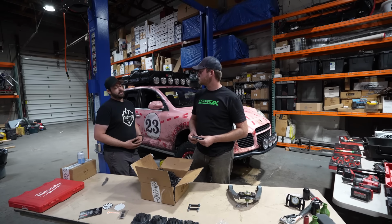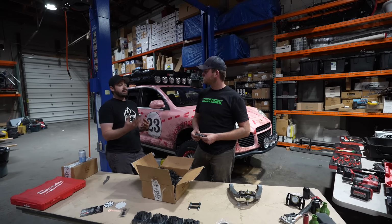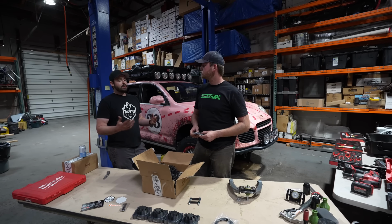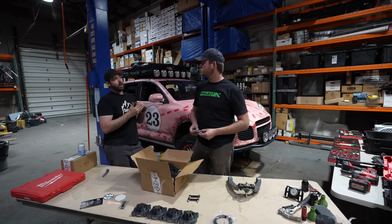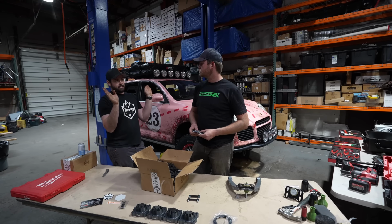Another reason why we went this way over an adjustable end link is because we keep the rod ratio correct. So when we install everything, I'll show you what I'm talking about rod ratio wise, but essentially if you go too short on the level link, you'll throw the arm sweep off, and as soon as it gets to one point, it'll peak out and snap off the rod.